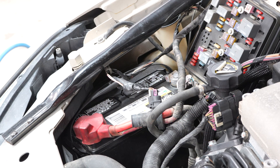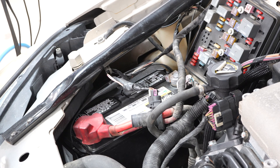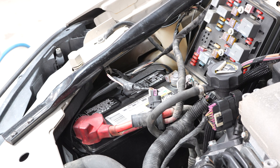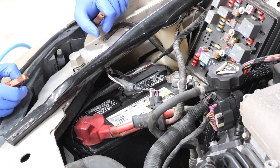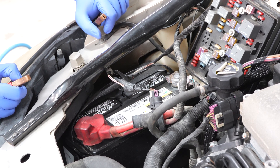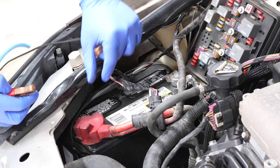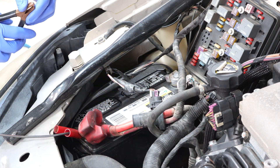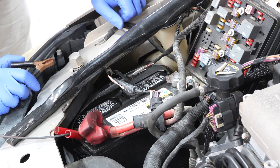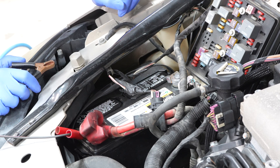The next thing I'm going to do is an optional step, but I think it's a really good idea — I'm going to put on a battery tending device. This will just provide the battery with a small amount of charge as I'm working on it. You might want to do that just because starting the engine over and over again is a big job and takes a decent amount of current. We don't want the battery to be dead after we've done our compression test. So I'm going to hook up a battery tender — it doesn't need to be a jumpstart box, just a regular tender. I've left a link in the description for a fairly inexpensive one; this one's only 1.5 amp.